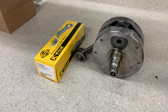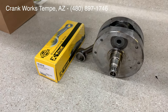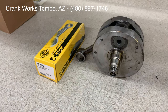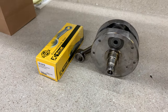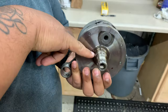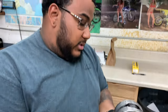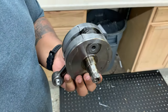Fully rebuilt crank with a new rod from Crankworx in Tempe. Luckily they're local so I was able to drop it off and pick it up about a week later — super rad guys. I'll have their information in the description. Even if you're out of state, they are the go-to people for having your crank rebuilt and done right. They measure main bearing press fit on both ends, also measure the pin bore and pin to check for scoring or pitting, and if there is any they highly recommend replacing it.